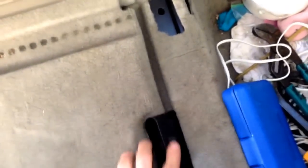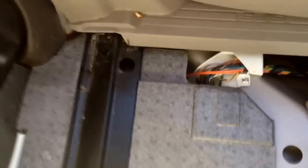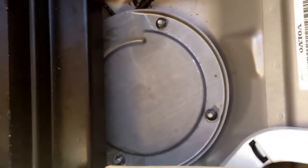The carpet is actually split right underneath the seat, so after you remove the second row seat you just pull the carpet back, take off the styrofoam, and you'll see the access door. There is the access to the second half of the fuel tank, where there is a secondary fuel level sender and a little hose that connects.